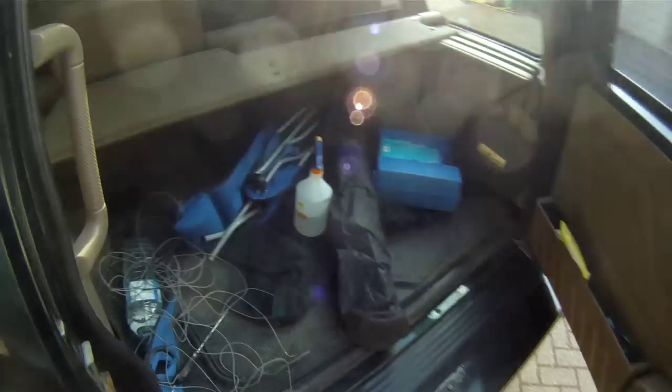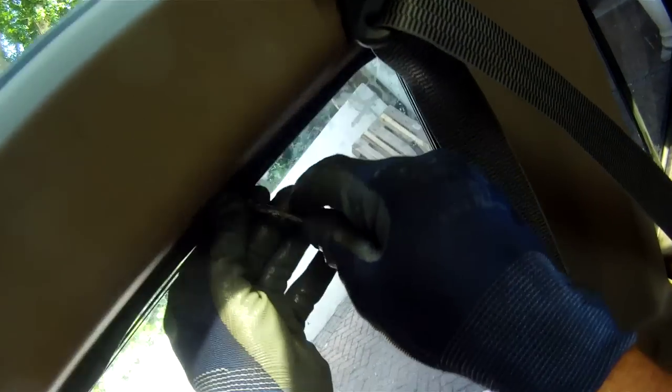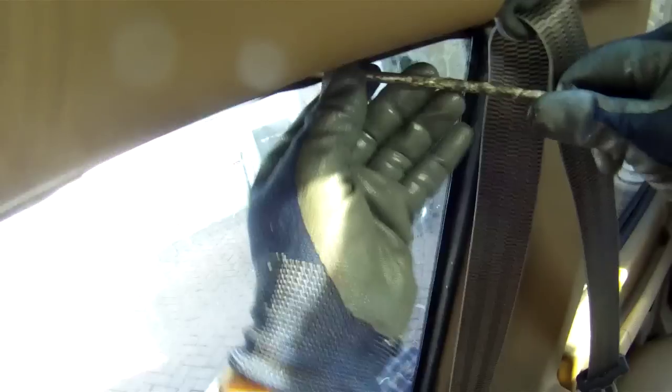Now we'll check on the inside. Rubber is in the right place. It's getting there. Certainly is over the lip. Maybe missing just a little bit here. Yeah. Which we can rectify with either a piece of plastic or just grabbing hold of the lip over with a screwdriver and working that rubber over a bit more. There we go.